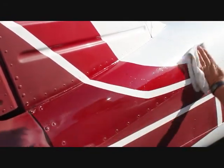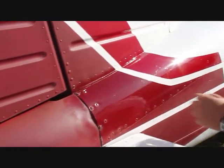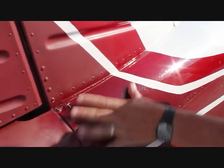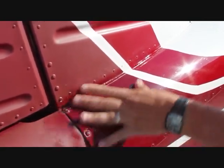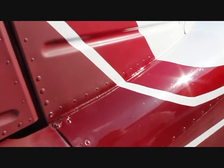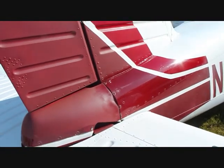You can see now you've got just a beautiful, beautiful shine on what was a dull red surface. You've got just incredible shine on this particular area as opposed to what it was before. That's Acrylic Works on the back of a plane in three different colors. One other little test — take your thumb and try to work it off so you can get some idea of the durability it'll have against rain. If I can't rub this off with my thumb, and whatever fingerprints are left, just take your dry hand and wipe away your fingerprints. That's your durability. It looks like a candied apple versus the untreated sections. That's Acrylic Works on the back of a plane.